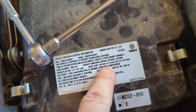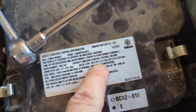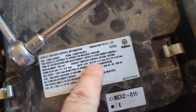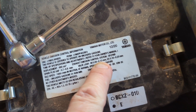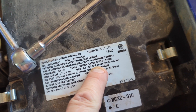You want 0.09 to 0.13 millimeters on the intake. When you check them, start with the feeler gauges at 0.09 — if it's tight then you know you've got to loosen them up a bit.